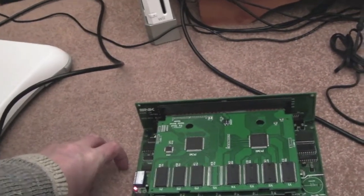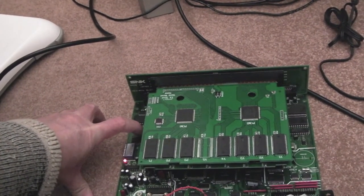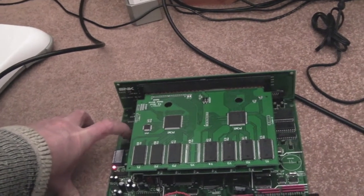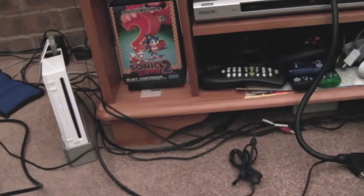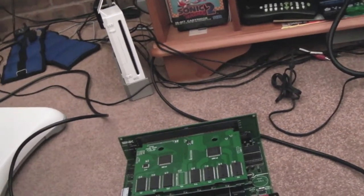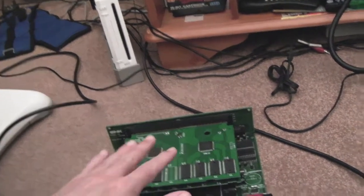I think this is about trying to understand if anybody knows about the electronic theory, not really mathematical, in terms of what effect is going on here when I'm just moving my finger over there. I'm not touching the pins, and let me be clear, I'm not touching any of these pins on these chips. I'm just hovering over the board, which is protected by a silk screen, so there is no physical interaction going on here between me and the board. This is purely to do with some sort of capacitive RFI noise type thing, and the design of this board.